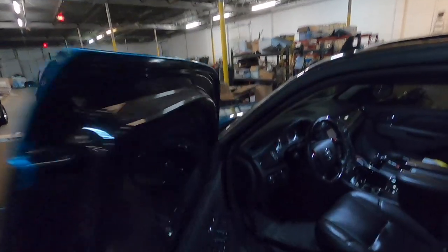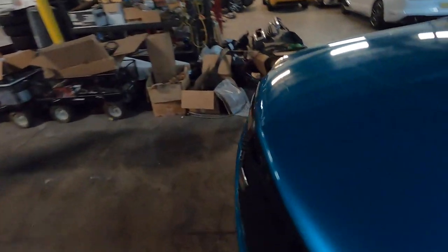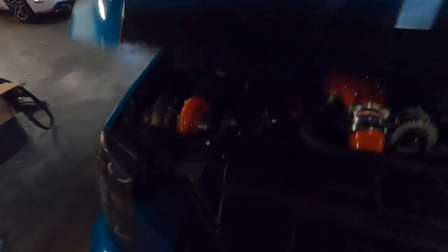You need to let it warm up before you just turn it on and shut it off. And even more so if you have something that runs on E85, because you have all kinds of moisture coming out of the exhaust when you first fire it up, and that stuff will sit in your turbine housings and rot stuff out really quickly. I got a full explanation from Robert at Force Performance as to why you need to do this, but before we get to that, I'm going to fire this thing up and show you how much moisture is actually in there. My downpipe is still disconnected because it's not done yet, so it'll be a great example.